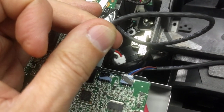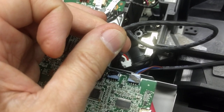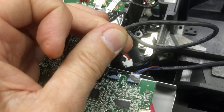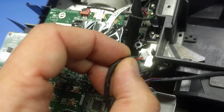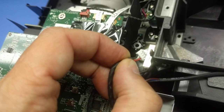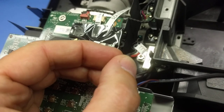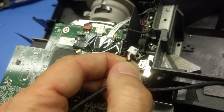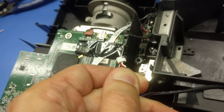And like I said, I wish we had time to do the microscope-based video. But the insulation will not fit into the connector housing, and oftentimes when this also happens, when you go to crimp, the contact is distorted by the wire insulation, which is larger than the contact was designed for. And if you can see by looking at it that it's mighty darn big to fit in the holes of the back of that connector.